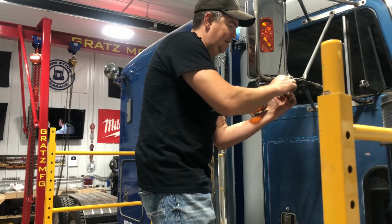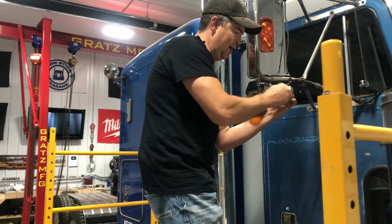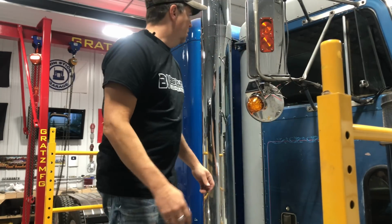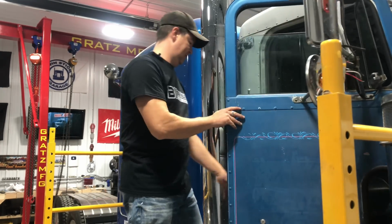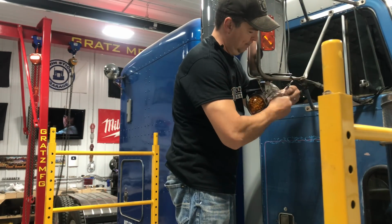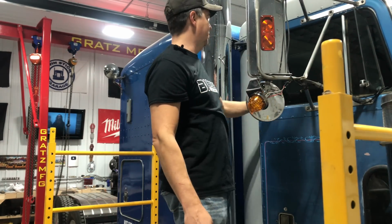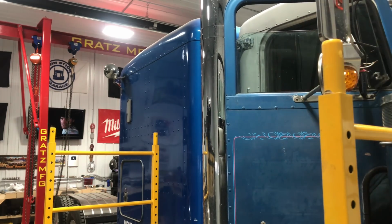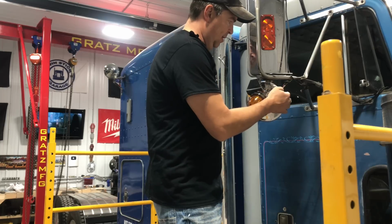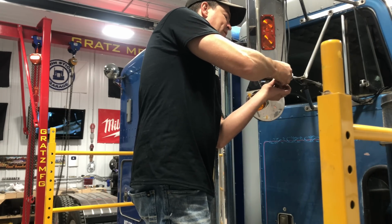Now, the wiring on these old trucks, the tail lights, the brake lights and the signal lights share the same wire. So I don't know if I can actually make this work. I'm sure there's a way. Okay, so turn on the signal light. Yeah. Something like that. Now maybe I just leave the black one off, but we might not have clearance lights. Yeah, I haven't wired the clearance lights. What I can do is wire it to this black wire and then eliminate the brakes, because that's probably where the brakes are coming in.